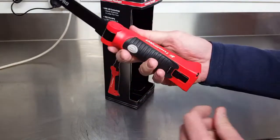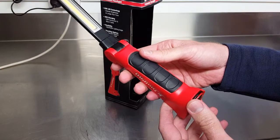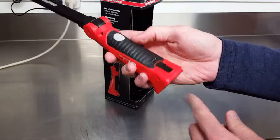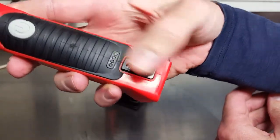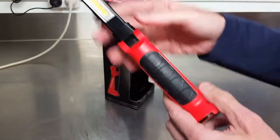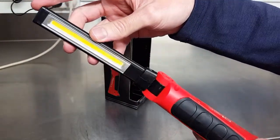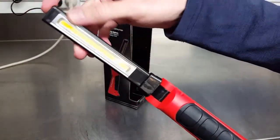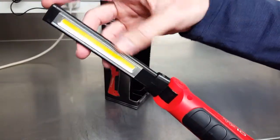So far I'm pretty impressed with this one — been using it all afternoon. These newer style rechargeables don't have a dock; they use a USB 5-volt micro USB port, so everyone's got a charging source. They use COB LED — that's chip-on-board — not a surface mount diode, so there's not a multitude of diodes along the length, and therefore you get a much more consistent light output.